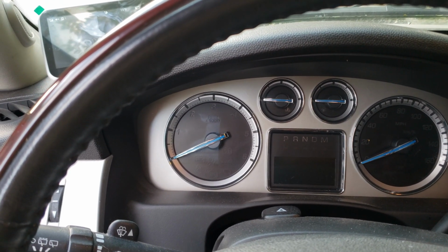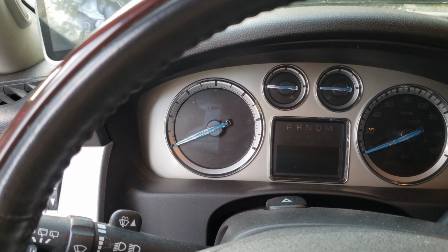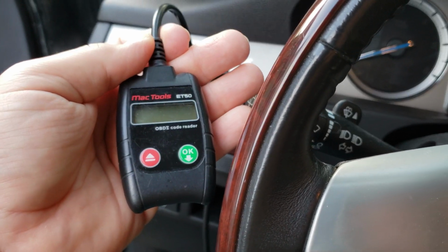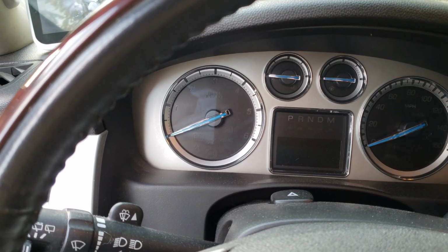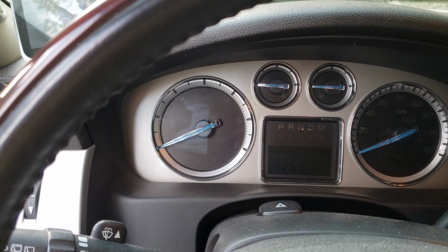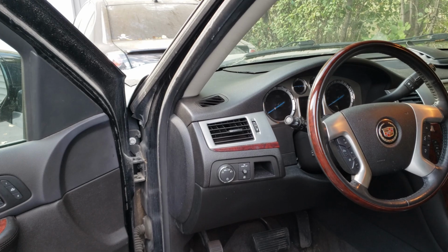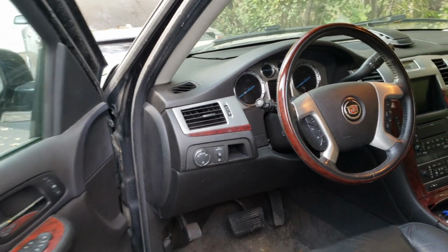And we went for longer than I would have liked with the check engine light on, including pretty much all of last winter. Now, I kind of got around the check engine lights with just a simple code reader. So if you pick up just a simple code reader, you can have it clear the codes, and then your remote start will work, at least until the ECU runs the tests that trigger the code. So I could get one remote start, maybe, but sometimes it was so bad that it would just stutter and stall. But man, was it a pain in the butt, because I had to remember, pretty much when I parked it, to go ahead and clear the codes. That way I'd have remote start in the morning.